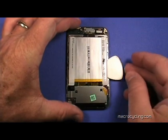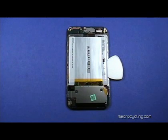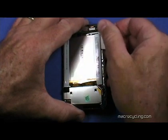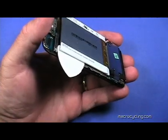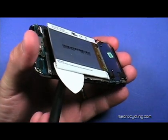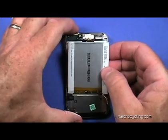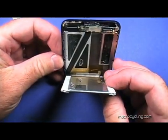With the plastic pick between the battery and display, gently and carefully work the pick around the iPod to loosen the glue points as shown. Once the glue is loosened up a bit on this side, a black stick can come in handy to gently pry up the battery. Move the battery back and note the ribbon cable is undamaged.